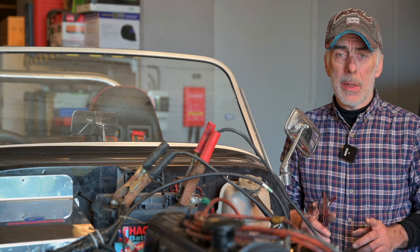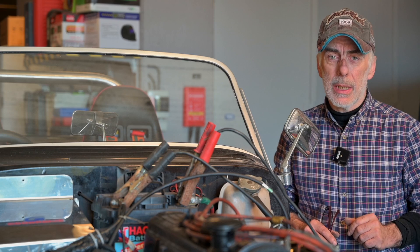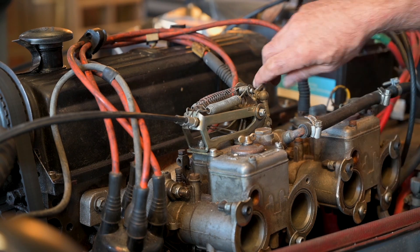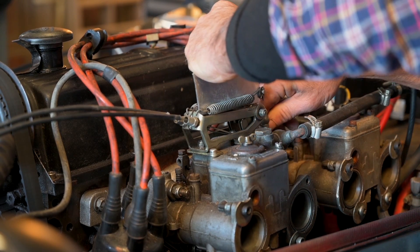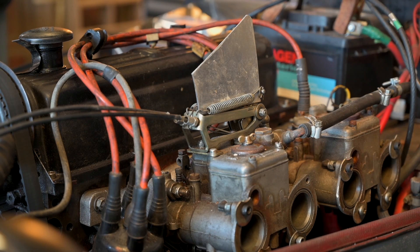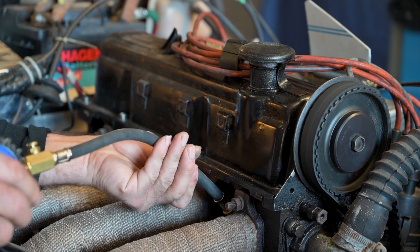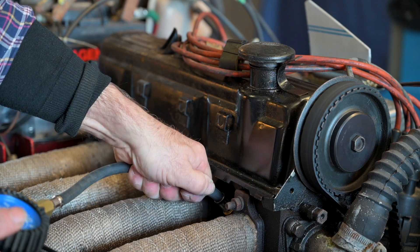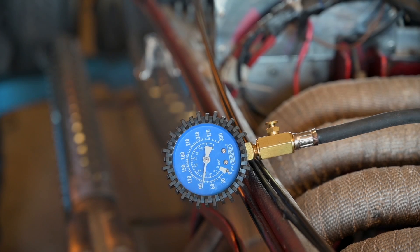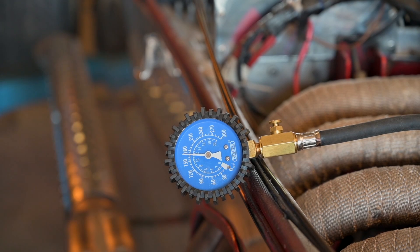When you do a compression test, do it with a warm engine, have the gas throttle fully open, and let it spin about eight compression strokes before checking the reading. I need to block the gas throttle fully open, so I'm going to use a piece of aluminum for that. There we go — now that's blocked and fully open. I put the compression meter in; you just rotate it by the hose, it doesn't have to go in very tight, just make sure the seal is closing up the spark plug hole. That should be enough — we've got a really good reading of around 12 kilograms, which is great.